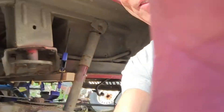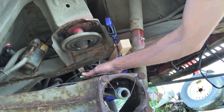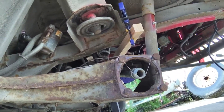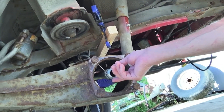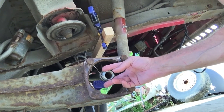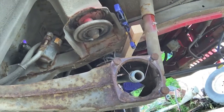Now there's a huge unknown: this trailing arm is pretty deep and even on the Volkswagen, the driveshaft gets really close to hitting the hole on the inner side when you're at extreme travel of the suspension. So what you see here is a little bit of welding wire and some electrical conduit, holding the conduit centered where the future center of the CV joint is going to end up. This is the pivot point for the axle — the conduit is doubling as an axle just for measurements sake.